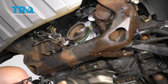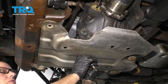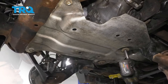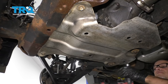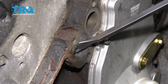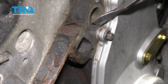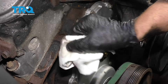Now if you have these covers — one under here and also the plastic one up front — you want to put those on. Snug up the bolts. Now you want to clean up the sealing surface where the water pump's gonna go. Just use a scraper — if you're careful, you can use a razor blade. Scrape any excess gasket material right there and also right in here, and wipe it down with a rag and some brake parts cleaner.